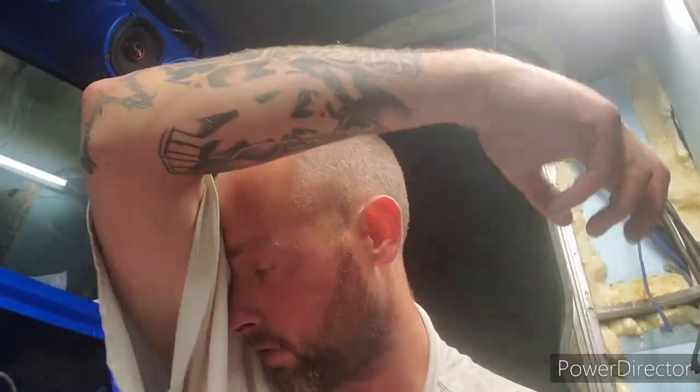So if any of you ever broke a brake chamber running down the highway, you know it'll lock up a tire or a set of tires really quick. And you got to rig some stuff up. You got to get up under the truck and pinch the line off, and it's not the right way to do things. And it's greasy, it's funky getting up under there. I'm trying to simplify things, so if I ever run into that situation, instead of crawling under the truck with zip ties or whatever to try to get that line pinched off, all I got to do is shut off the valve.